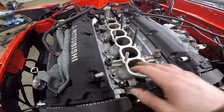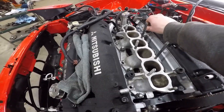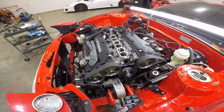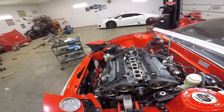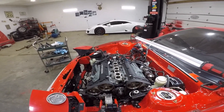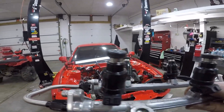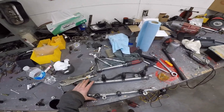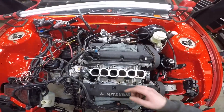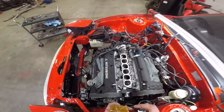This is where your fuel rails bolt to. I super glued these plastic pieces because I've dropped them before and then you have to take everything apart to get them out. I don't know exactly what they're for — maybe just a little buffer for vibration. Super glue will break before the rail breaks, so that's just a little trick I'd share with you guys. Let's get these fuel rails on. If you're new, these are 800cc injectors and you should put a little bit of grease on these o-rings. I couldn't find my good lube so I just used a barely a little bit of oil on all of them, which will be fine — if anything it'll just spray some oil down in the cylinders on startup. I just want these to slide in as easy as possible.